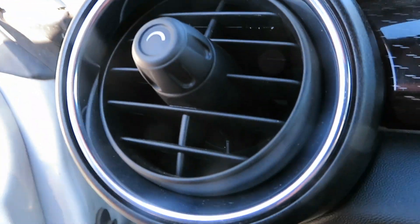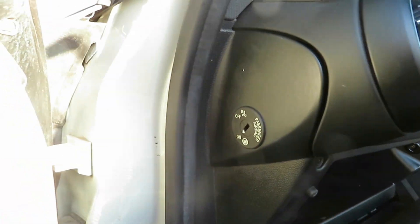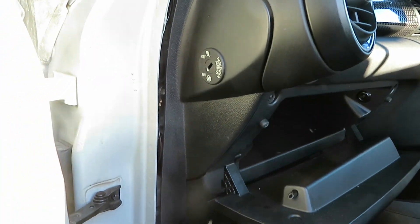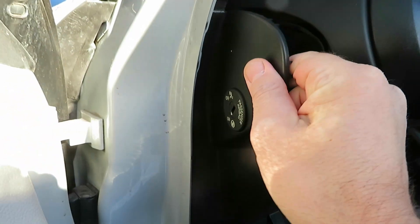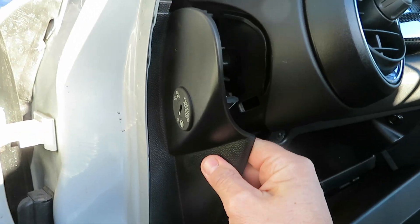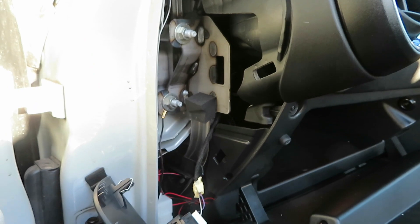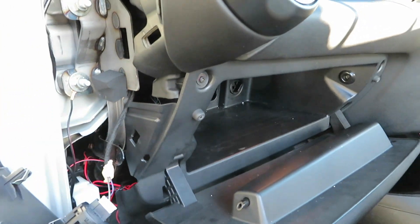All of the cable, everything nice and neatly tucked away around the back. So first of all, let's just pop some trim off, starting from here. Just pull the rubber seal off for the door — this comes away nice and easy, nothing major about that. Then just pop this trim off here; you'll see it comes away pretty easy. If you can avoid taking this out, do — this is the airbag warning or the key. I did it on my car and it caused just a warning light, which was reset by the garage, but you don't need to take that off to access the fuse box from here. That's as much trim removal as you need to do.